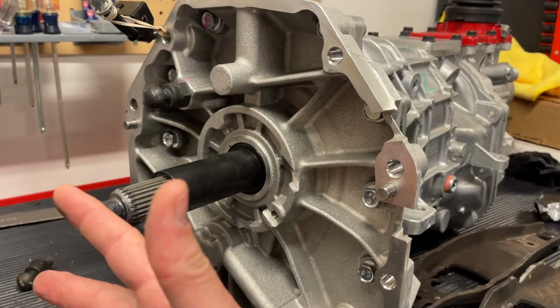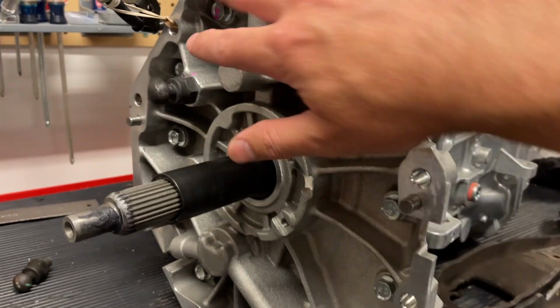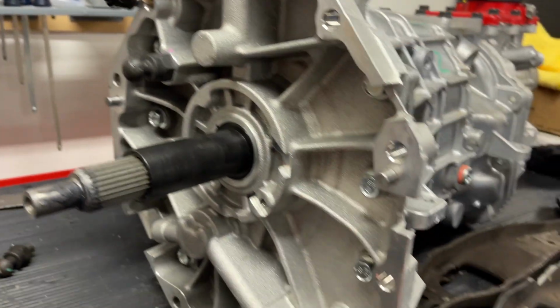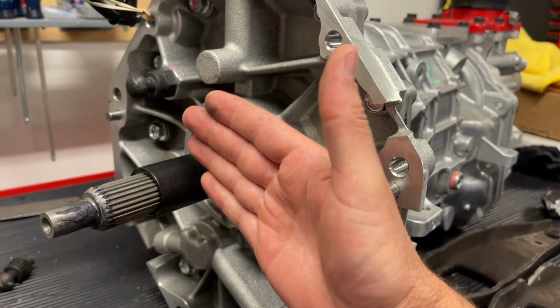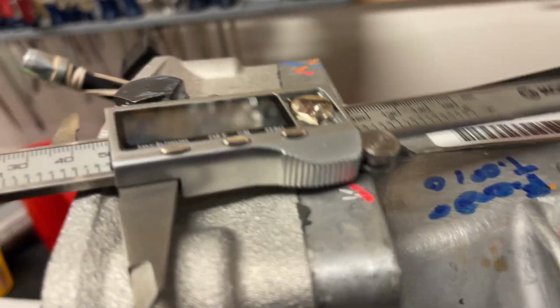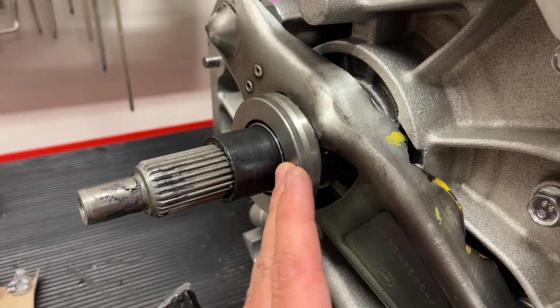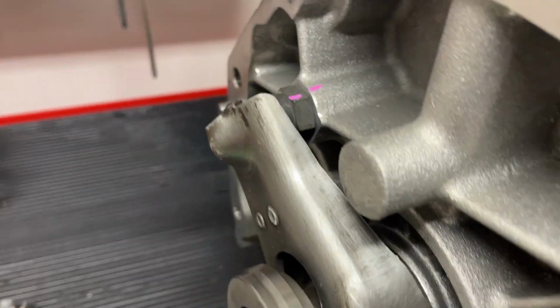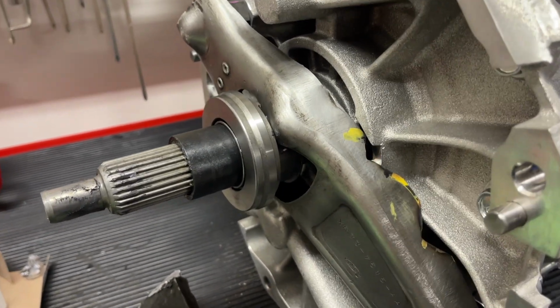So simply put, a deeper clutch makes it so that the throwout bearing has to go back farther. And with that said, it has to be with the shortening of the pivot ball stud and/or notching that clutch fork to get that throwout bearing back, so you're not already smacking your throwout bearing against the diaphragm fingers as you're trying to. Now, by comparison with the T56 Magnum, the distance with the stock pivot ball is 48 millimeters. So right now, as it sits, even with the little notching, which we'll show you later in the video, we could barely get it to where it would be touching the diaphragm fingers of the clutch as it's installed. So we will need to use that adjustable pivot ball stud to gain some room and notch it possibly.